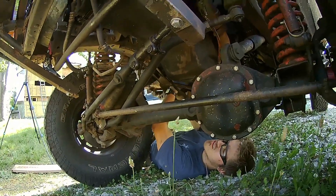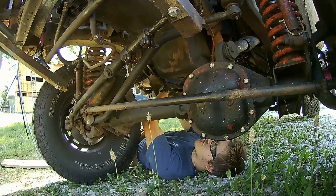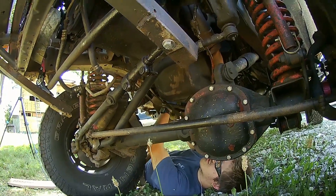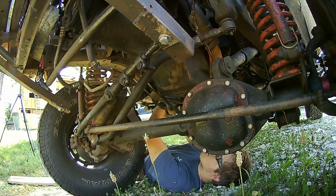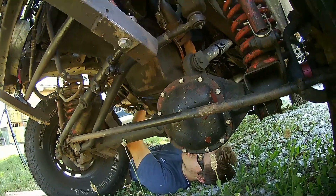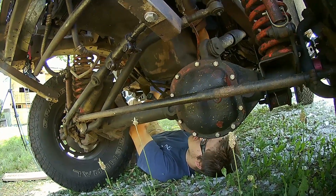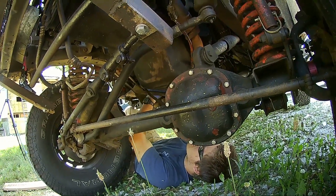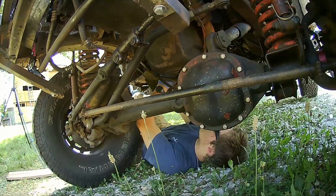The bolts aren't reusable — you have to buy new ones. They're typically not that expensive. If any bolt is torque-to-yield, most of them are head bolts, cam retainer bolts, and some main cap bearing caps — you can't reuse them, they have to be replaced. Those are the only things I've seen, besides some BMW engines, that use 12-point heads. Six-point is far better in that it does not strip things. The 6-point has a lot more meat along the edges of the bolt where the 12-point doesn't, because there are long flat surfaces where it grips in the corners. A 12-point doesn't have that. So if it's an old bolt with some corrosion, it doesn't have a big surface area and it's much easier to strip them out. So if avoidable, don't use 12-points.